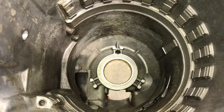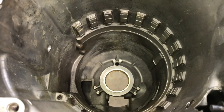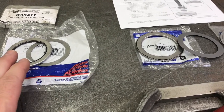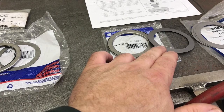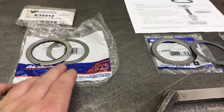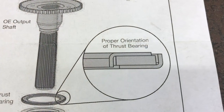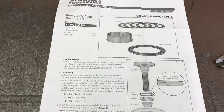The installation of the bushing is about as easy as it gets. I drove it down through with the Cam Bearing tool so any debris fell out, wiped out the bore, and installed the No-Walk bushing until it stopped. There's no thought process involved — it's virtually foolproof. Comparing the bearings themselves, they're the same thickness, about 140 thousandths apiece. This kit came with two 10 thousandths and two 15 thousandths shims. I'm going to start with one 10 thousandths shim, just like I'm doing on the other side. These shims are obviously larger to match the larger bearing, and the TH350 pump shims match the TH350 pump bearing. I test fit it up — it's beautiful. No play. It spins nice and easy. The instructions tell you how to orient the bearing, so you can't mess that up either. This may be a $30 kit, but it's pretty nice.